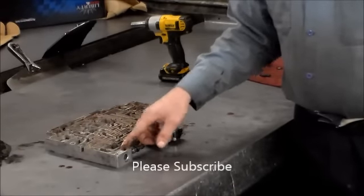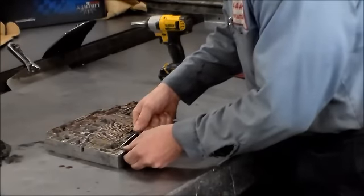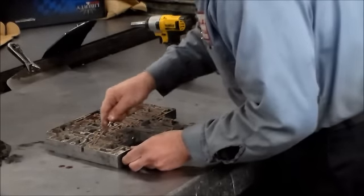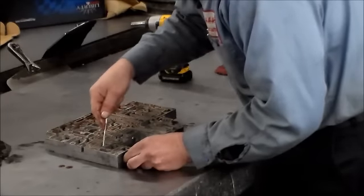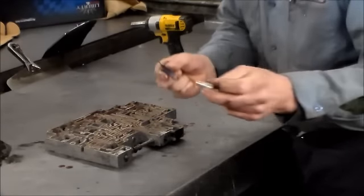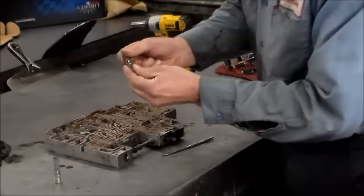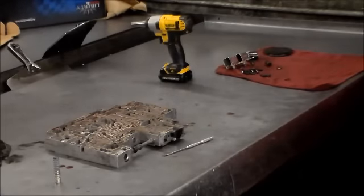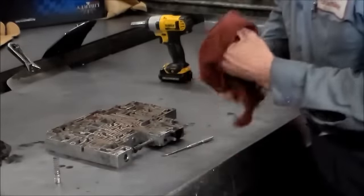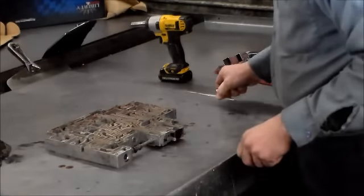And I always update the pressure regulator valve. So we're going to pull that valve train out. Okay, we're going to put the clip aside. All right, inside here is the boost valve. Here is the spring. And here is the valve. This valve has just a little wear to it, not bad, but again, this is a work truck, and we're going to be updating this.